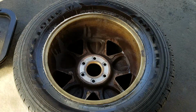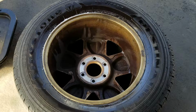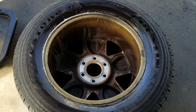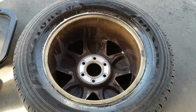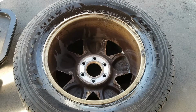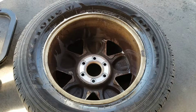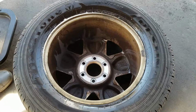Now, if you have a big leak or anything like that, then that's going to be pretty easy to see, but sometimes it's not so easy. So if you want, you can have someone, either yourself or someone, kind of go onto the tire as well, especially if it's a very slow leak. So if you have something where we're losing 5 psi or 10 psi a day, you should be able to see that. But if it's something where you're losing like 3 or 4 psi in a month, which is still a leak, but a very slow leak, then it may not be visible right away.